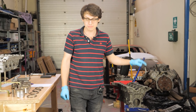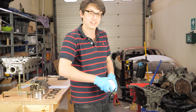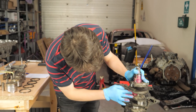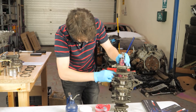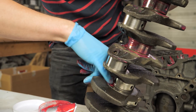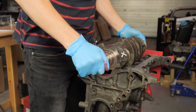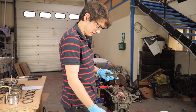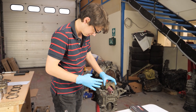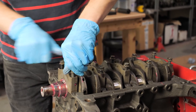Now our squirters are in. When they're easy to access, we've got to put the crank in. In order to do that we need to lubricate our bearings with our assembly lube. This one's the thrust face for the thrust washers because it's way bigger. Then we'll drop it in - crank is in. Now we've got to do the same for all the main caps, lubricate them and chuck them on. We'll start each of these copper threads, torquing it down two stages in the spiral.